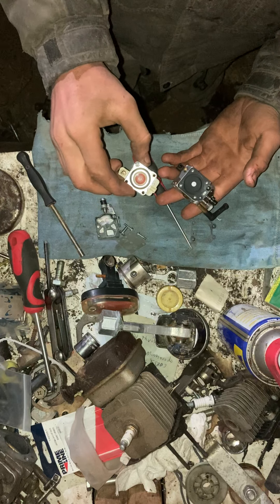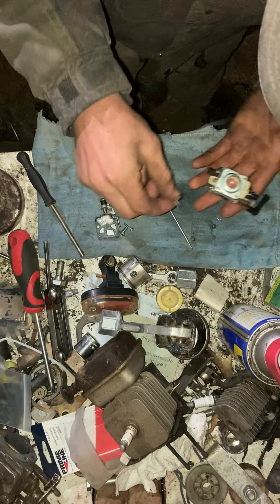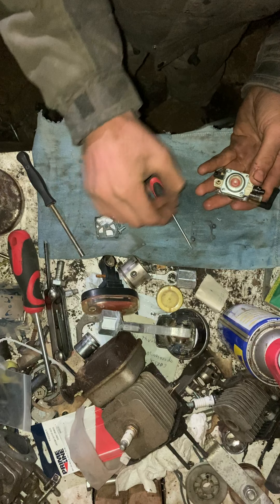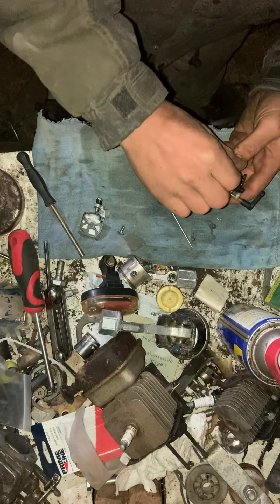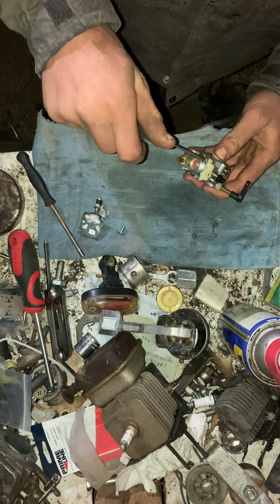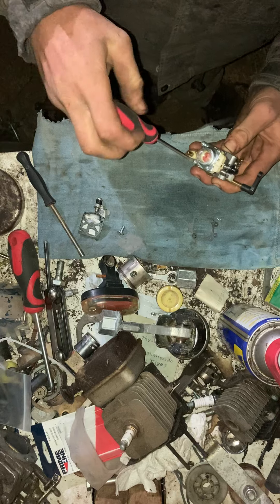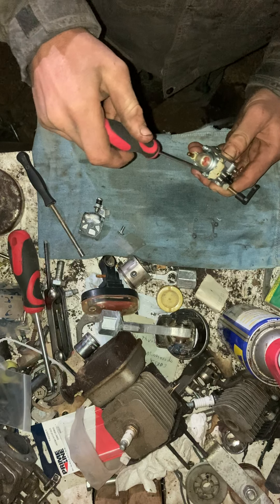This little pink flap under the primer bulb — don't even worry about that unless it's broken, in which case you might want to find your own rebuild kit. I've never had a need to though; they've always been intact. Either that or the carburetor was totally done. So if that flapper is disintegrated, chances are the carburetor is pretty much dead also — just buy a new carb.